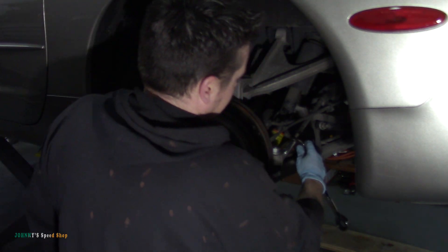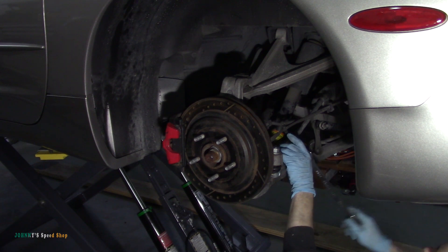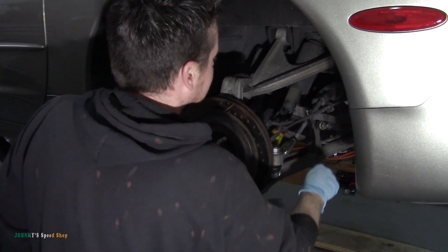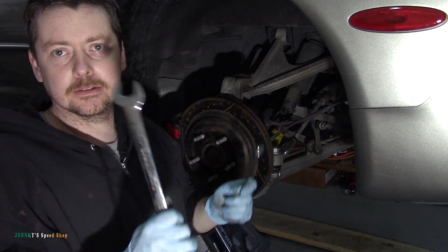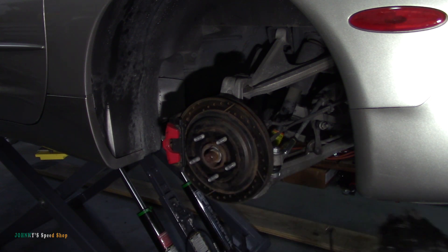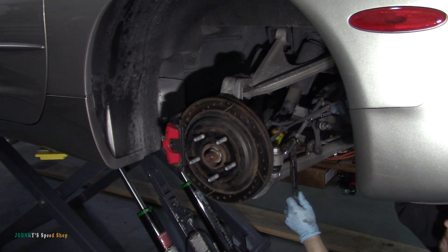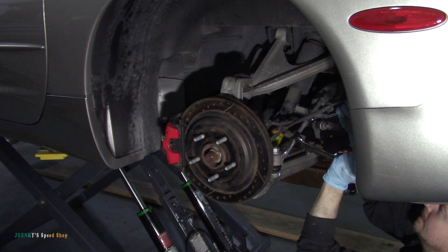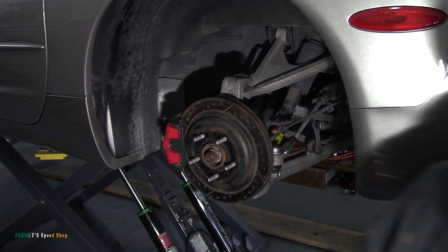I might look up the torque spec. Don't forget to tighten up your jam nut with your 22mm. My whole rod is turning — grab yourself a 12 or 13mm. So grab your 13mm and your 22mm and tighten back up your jam nut. The 13mm is just for holding the rod that's going into the frame here. Hopefully you guys can see what I'm doing. She's tight.